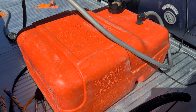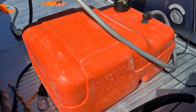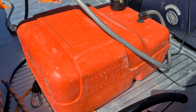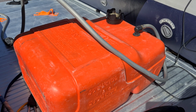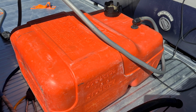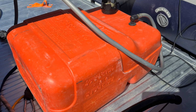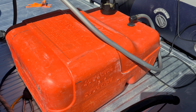Right, talking about fuel. 25 litres there, that's 25 litres of 50:1 two-stroke mix. I use 96, I always think it's best with an outboard to give it the best you can. 50:1 and a good quality two-stroke oil. The recommendation for fuel is a third to get there, a third to get back, and a third in reserve. This boat on full throttle, experience shows, burns 5 litres of fuel an hour. So there's 5 hours of fuel there. We're travelling about 2 kilometres at 5 knots and 2 kilometres back. We'll be lucky if we burn a quarter litre of fuel, so we've got plenty of fuel.